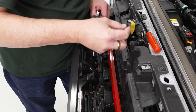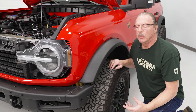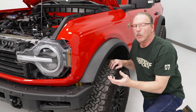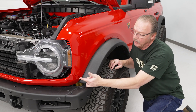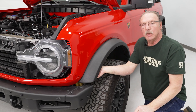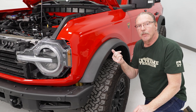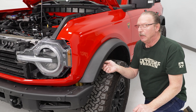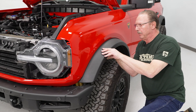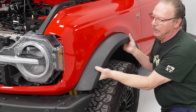Be a little careful when pulling this off — make sure you don't break anything because it is plastic. Now we can get our grill out of the way. The next thing we have to do is address a bolt at the bottom of our fender trim, so the fender flares need to come off first. It's a really easy process — no tools are required. There are five clips on the underside of the fender flare that we'll need to unclip, then simply pull it away from the fender.